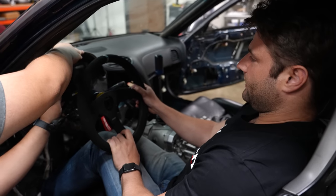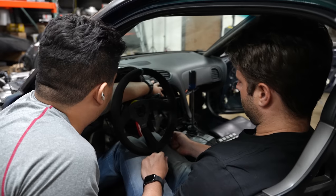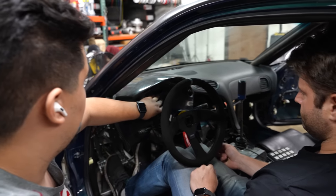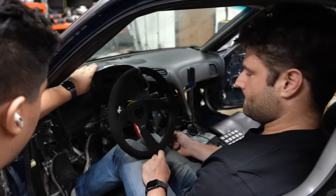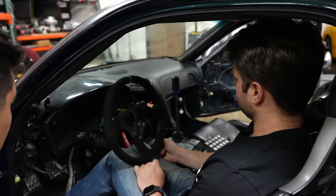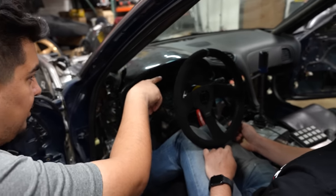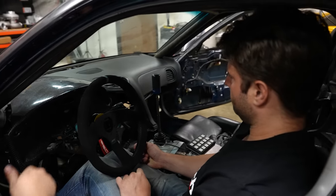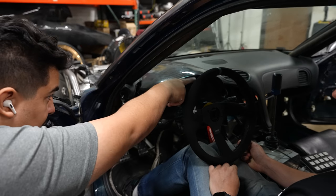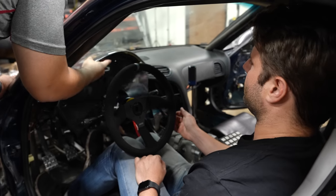That is pretty clean. I want to make all that out of plate and have that part of the dash come into this car, which is solid. So I want to have this be able to bolt in somehow, not with that bolt, have all that plate stay in the car, and then the dash just comes in from the passenger side and hits its three mounts, because it's only mounted by one bolt over there right now. I have a mount for the bottom made, I just gotta weld it on. It's not going anywhere. And so it did have to come up to match that over there. But it's in the perfect spot now. It looks aesthetic. It just looks way better.